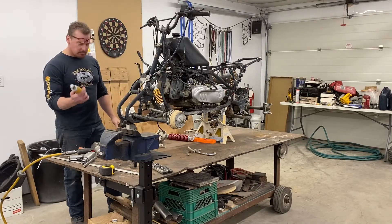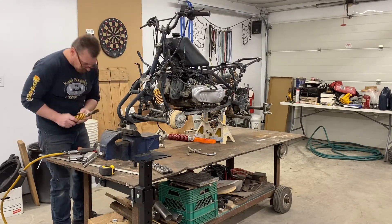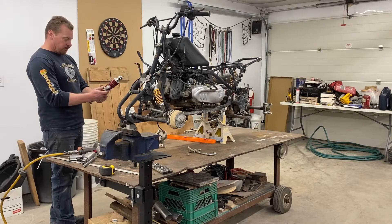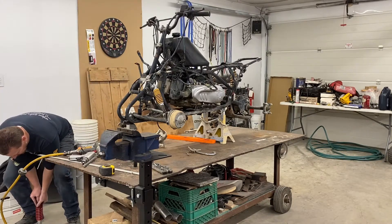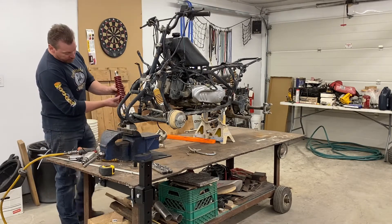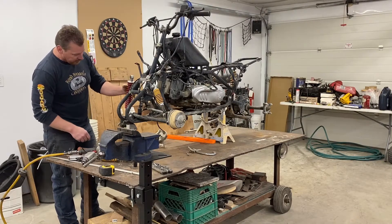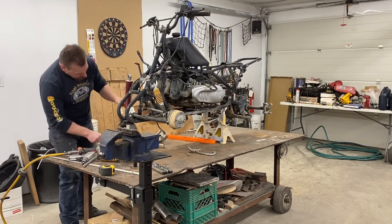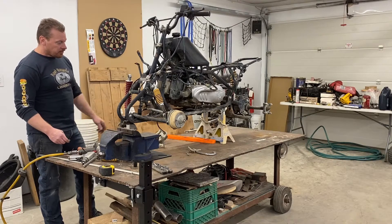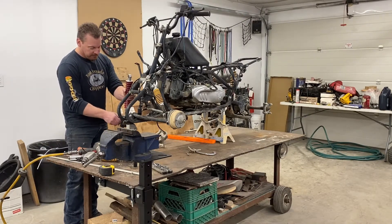This front end is basically gonna go in the garbage — it's very worn out, the bushings are very worn out. The little shock might be okay but I don't even know where I'd get bushings for it anyway. I have these bigger ones which are obviously quite a bit bigger — I want to make this front end as soft as possible because this is gonna be a pretty light go-kart. I'm also planning on extending these control arms out; overall width I'm gonna be close to four feet.